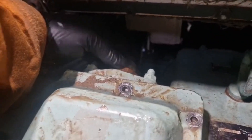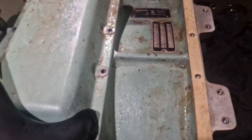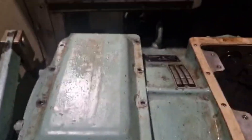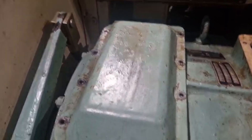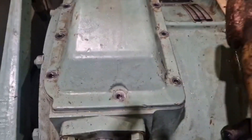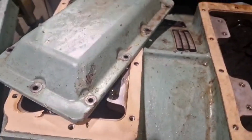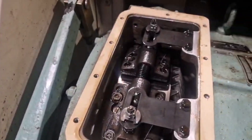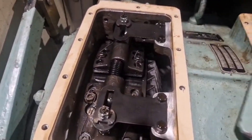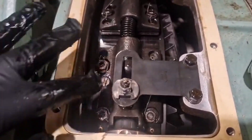You've got your lock nut at the back that you have to undo. Remove your 7/16th bolts from the top, and then because this one's never been out, a little gentle tap — and there's the brake bands. As you can see, these have never been out since the factory.